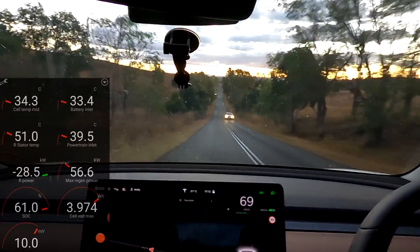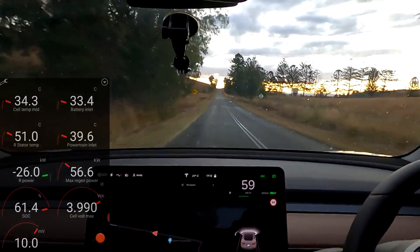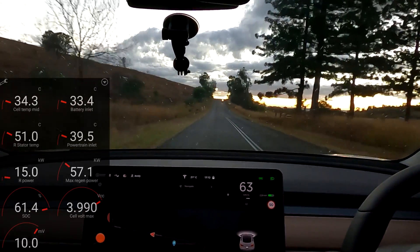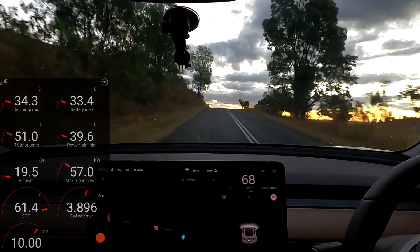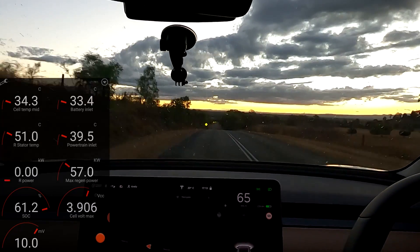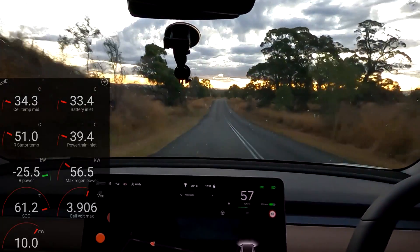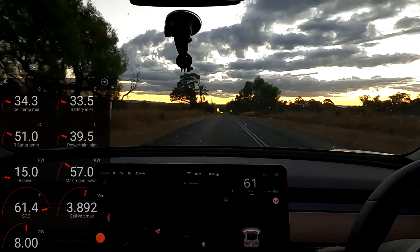Let's do it again here. Braking now. Off the brake. You can see the green bar and the number. Braking now. Off the brake. There's nothing happening in regards to more regen when you brake. Definitely — if you brake in a Tesla it brakes, it uses the friction brake. There's no additional regen power going into the battery. This is totally mechanical friction braking. The next question is: who is using the low regen braking?